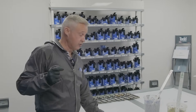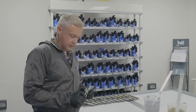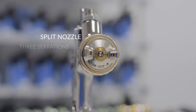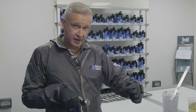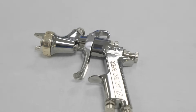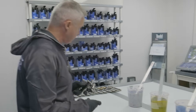The first gun in the process is the W400 WBX. Like all the rest of these guns it has split nozzle technology — the nozzles are split and cross-cut. As the air comes across the nozzle it falls into the serrations, putting air into the centre of the paint stream, which stabilises the droplets, making them very fine and consistent. Then at the air cap it atomises twice, which means we can balance and optimise the size of the droplets, giving a really consistent lay down.